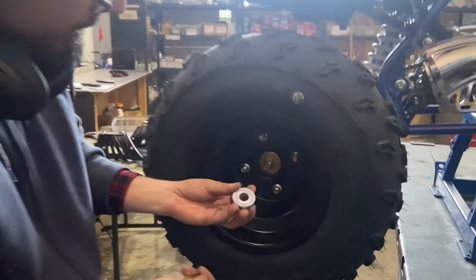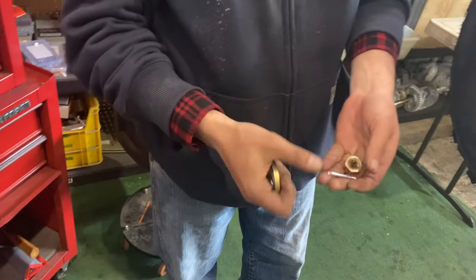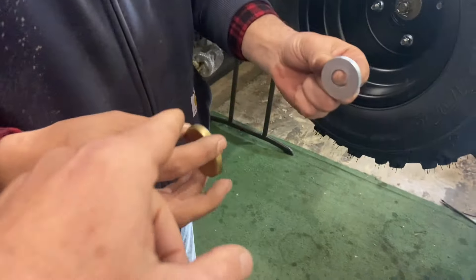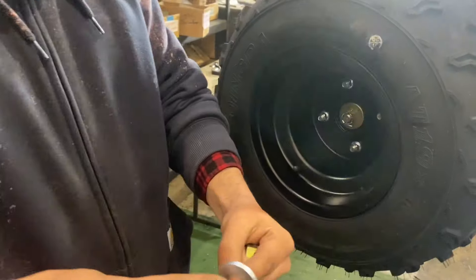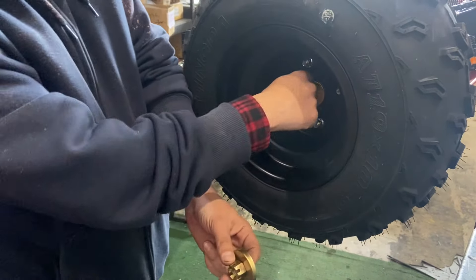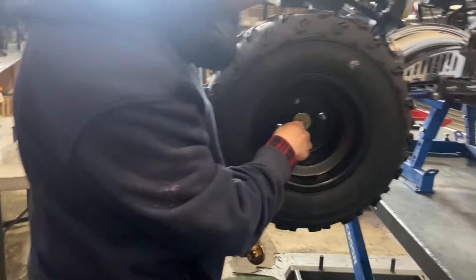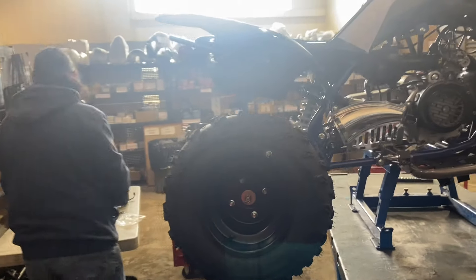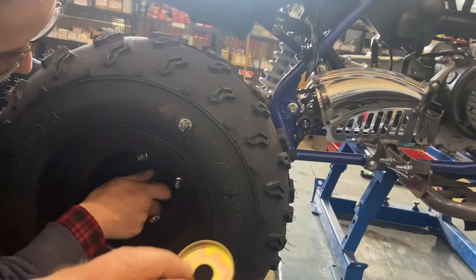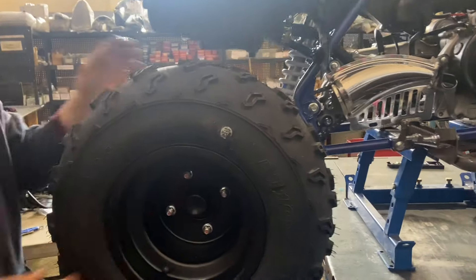Marcus installed the rear wheel. You're going to need three parts: a washer, a gold cap, and your castle nut with a cotter pin. Put the washer on, then the gold cap, then drill it on and line up the hole to slide the cotter pin through and lock it in place. Don't forget that cotter pin — lock it in place properly. The dust cap just pops right in with a little suction and fits right into place.